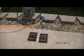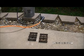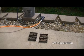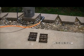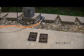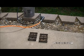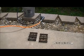And, yeah, I don't really use any other protective equipment besides that because spraying yourself in the hand doesn't feel good, but I don't really think it hurts. So, I'm going to go ahead and put this ugly cap on. I just want to make sure that everyone knew, get one of these. Don't just go out and buy a siphon gun and think you're going to sandblast all day long. You can, on the other hand, if you build your own media cabinet to hold this in, or if you go and buy one for like $400 to $600. But I'm going to get the blast in here.